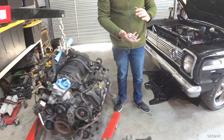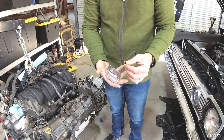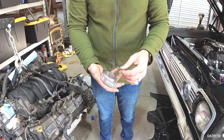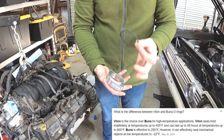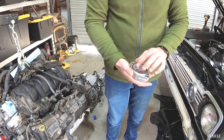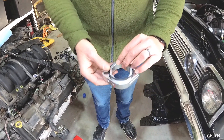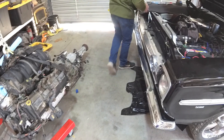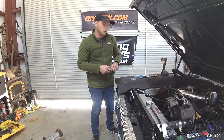Quick overview — we've already discussed this piece. We use a Viton Standard Series O-Ring, so it's not some custom O-Ring that is impossible to find. This is an off-the-shelf unit. It's Viton, which means it is chemically resistant to all automotive fluids. You don't have to worry about it degrading over time. It's one of the best O-Rings that you can physically get. It fits in this O-Ring gland and then this simply bolts in place of the existing water neck. So now we're going to go ahead and get to the installation.